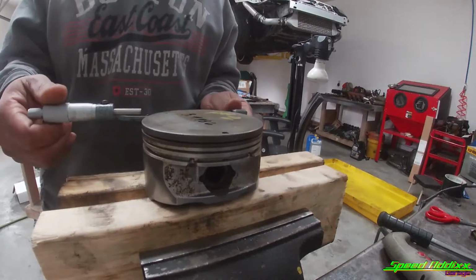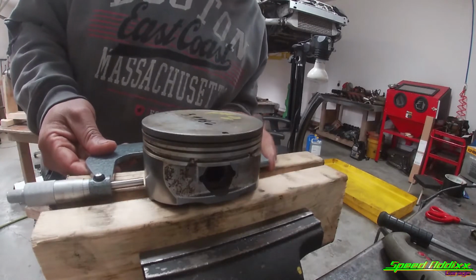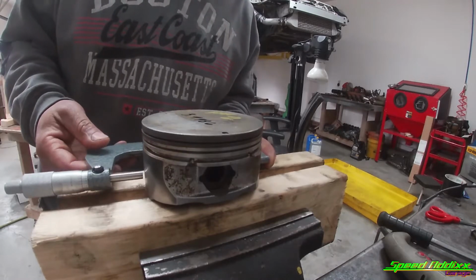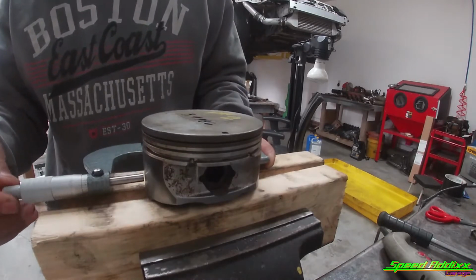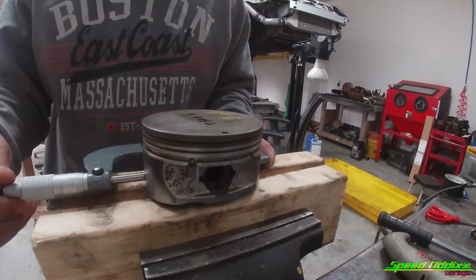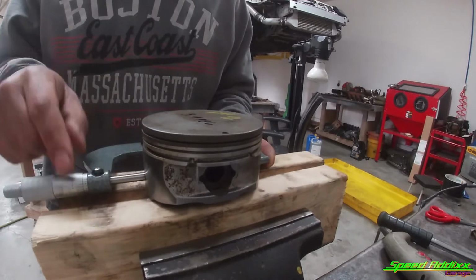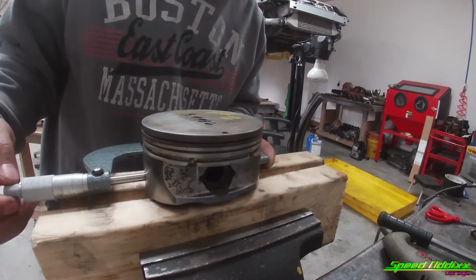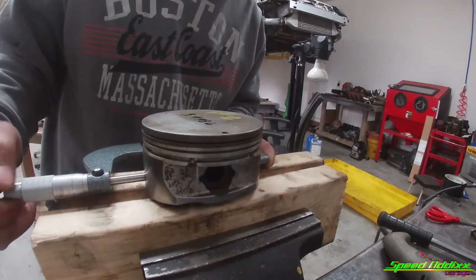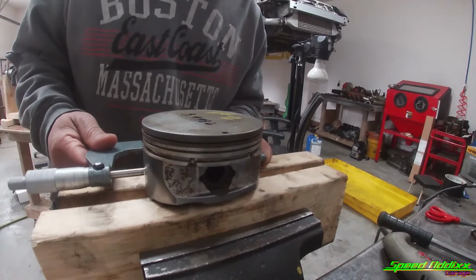Take your 4 to 5 inch micrometer, open that up. You put one side in the middle of that blue line, and then this side, you just use the torque, and you got to make sure when you do this, you need to move it around so that you can see that the flat section of this anvil is flat on the piston. And you just keep ratcheting it. And remember, this ratchet puts the perfect amount of tension on it.